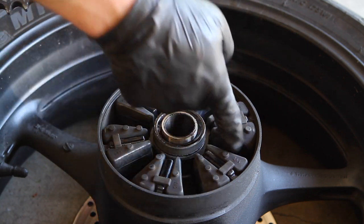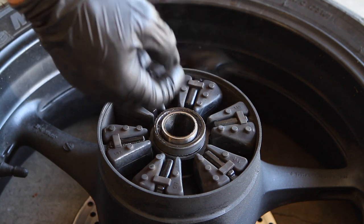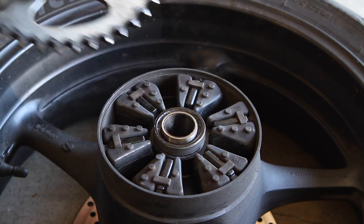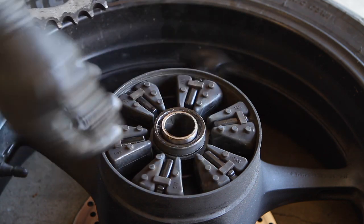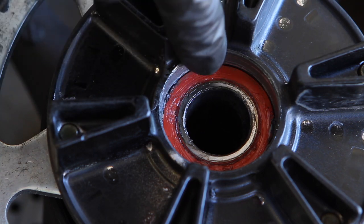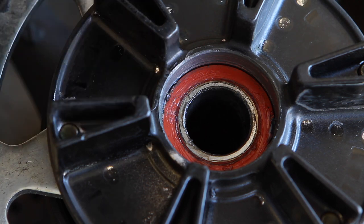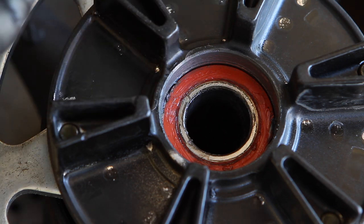We're also going to lubricate the mating surfaces of the drive hub here. Mine feel dry, so the manual basically says just a little bit of lithium soap based grease — I'm going to apply a very thin film so they have something to push against and interface the metal pieces with the rubber pieces. Also clean out inside the hole where your axle goes and lubricate that lightly so it's smooth and there's no corrosion between the two surfaces. You could go as far as using a pick to pull off the oil seal and push more grease in, or use a grease gun with a grease needle to force it through, but the manual doesn't recommend this and my bearings look sealed up fine so I'll leave it.